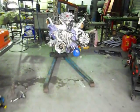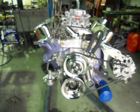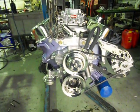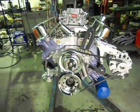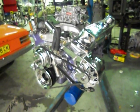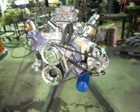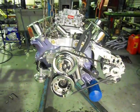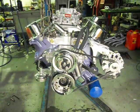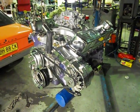First we'll run in the cam. Primarily what we're doing is running in the camshaft. Because it's got big double valve springs, I've only put one spring in when I assembled the heads, so it's easier on the cam to run in. Once we run the cam in — about 20 minutes around the 2000 RPM mark — we'll shut it down, pull the rocker covers off, all the rockers come off, and we pump up each cylinder with air to hold the valves up and put our double springs in. Then we can stretch its legs and see how good this puppy can go.